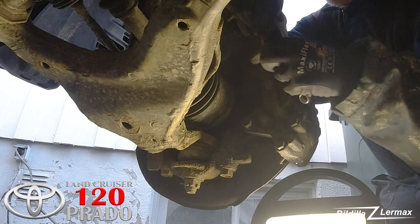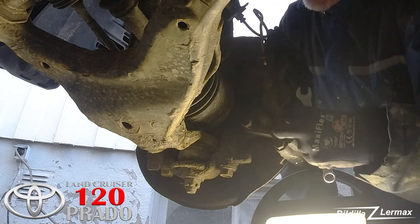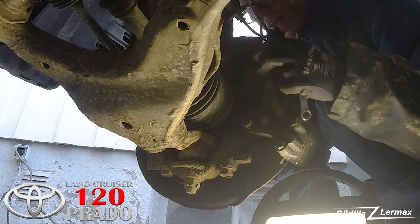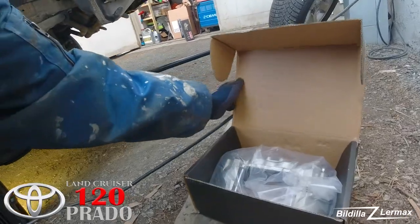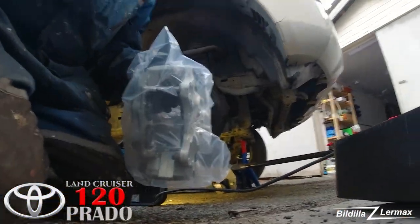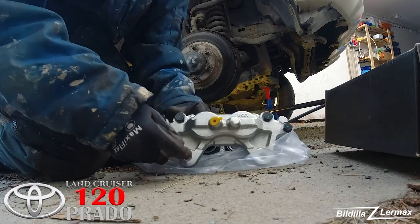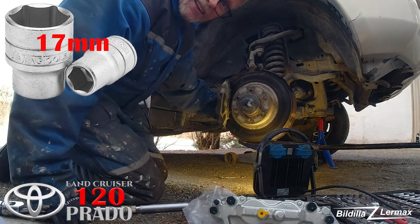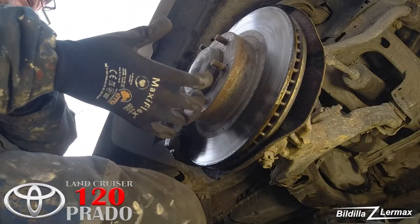Now I have to find the right gear — looks like it's 17 millimeters down here. I have to see if the new caliper comes with the holder on everything. Let me open the package to check. Yeah, this looks like it's the right part to use. It should be 17 millimeters — same as on the back — so I'll use the 17 millimeter to loosen it.